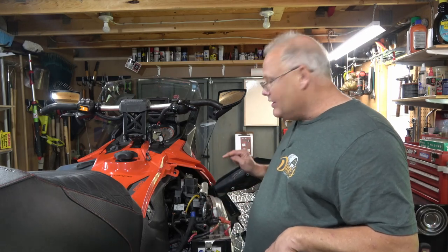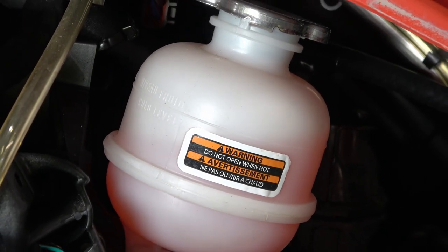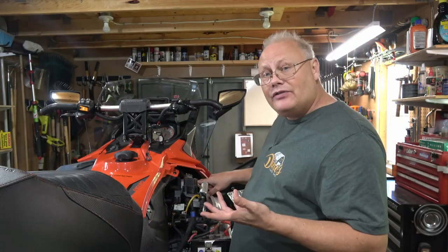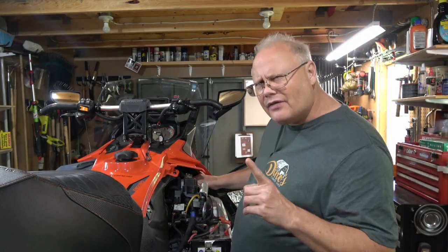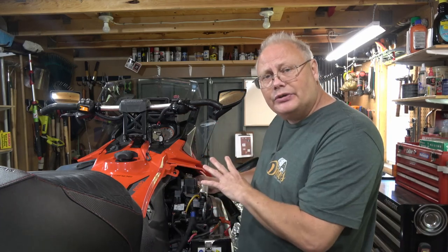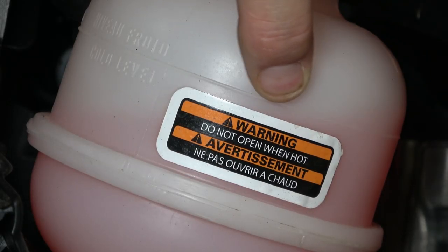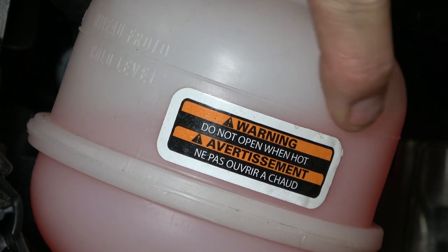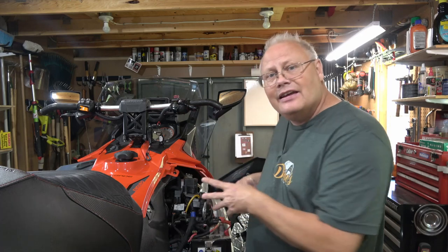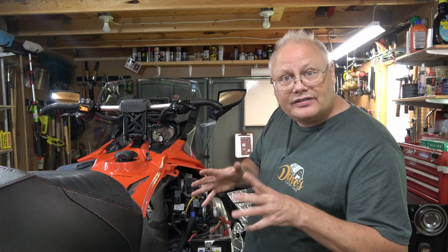The other thing that's underneath this side of the cover on my snowmobile is my coolant reservoir. Now, Skidoo uses an orange colored coolant. It's a long life coolant that's supposed to be changed, I think, every 5 years. So next year I'm due to change that coolant, but I'm gonna wanna make sure that it's topped up when it's cold to the proper line with the proper coolant. And I'm gonna take a look inside the engine and make sure there's no leaks anywhere that I can see that may indicate that I've either got a head gasket or maybe a hose that's leaking.